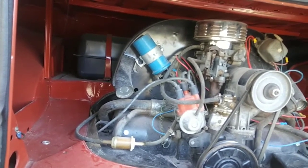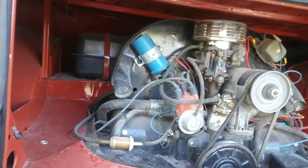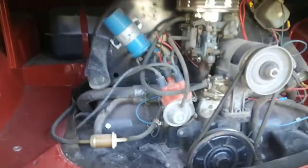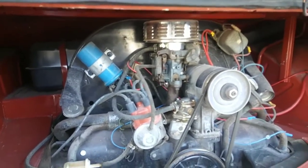One of mine has a 125. That's because I have a really big cam, and it's over-cammed, and it makes it run really cool. But those are extreme situations. I'm just telling you, it's typically 130, 135 on your main jet.